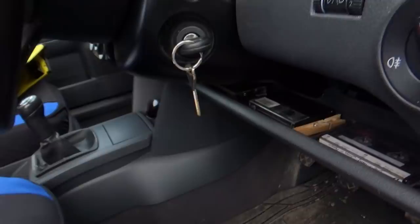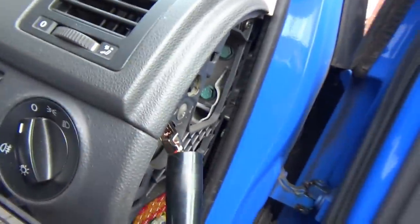So you saw that then. We had a live on both sides of the fuses, but on one side of the fuse we could hear that relay energising, and if you remember when I cranked it, we could hear a relay energising and de-energising, and the MIL lamp was flashing. So let's put a proper fuse in there and see what happens.